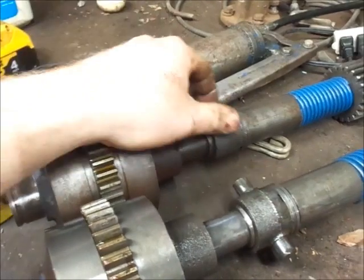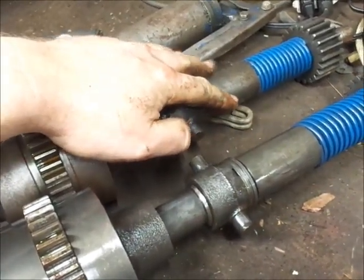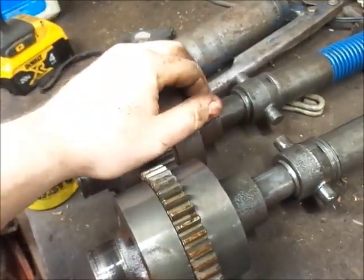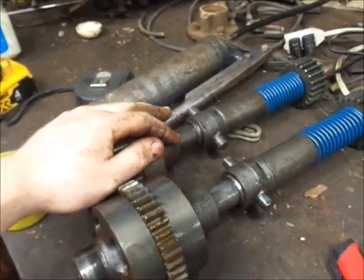Because the way you disengage these is you push this clutch fork this way, and that's what compresses this spring more and takes the tension off of this. That's why it's very, very important to keep the PTOs adjusted on an 8-speed rider.